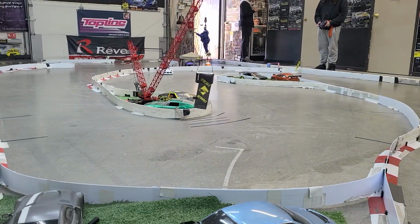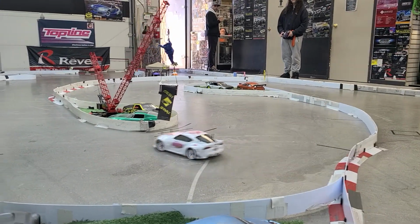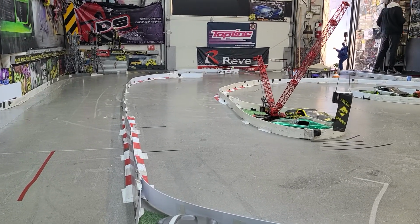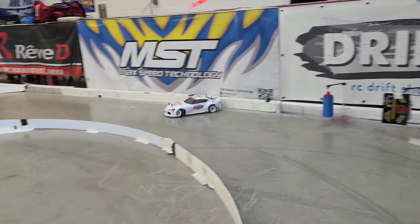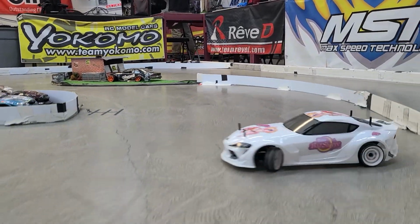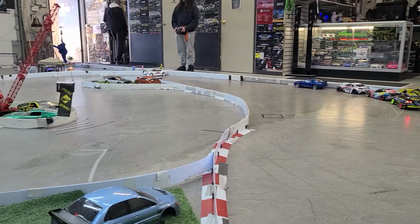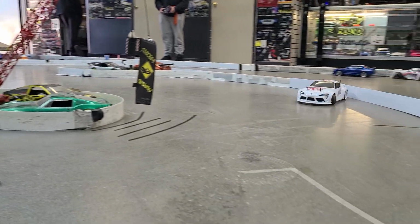But I noticed that. The only other thing is, I think one or two of the holes on the rear suspension mount, one of them is just a little bit off position because I have just a little bit more extra spacing between the factory spacers and the toe block. But honestly, it's very minimal. It's just something I noticed, and that's most likely because this is a prototype. So once the production versions of the Proteus chassis are released, I'm pretty sure those little things will be cleaned up. But otherwise, it runs very mint, and I'm very pleased with the results.